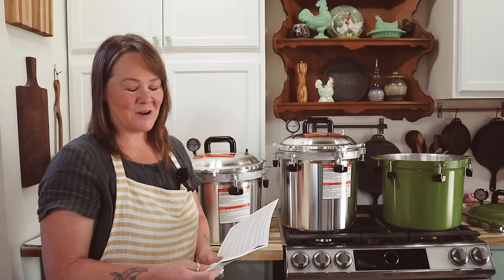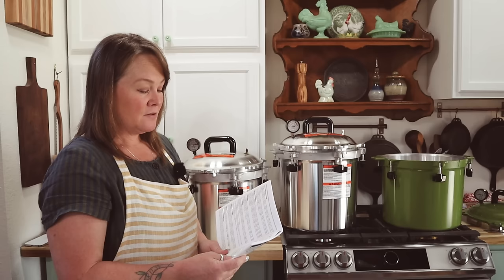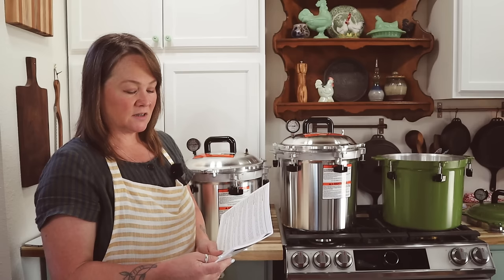Always store the pressure cooker canner in a dry area when not in use. While pitting is not injurious to health, if pitting becomes present and you detect it in the metal, then we recommend that the unit be returned to the factory for examination. Do not use the unit if pitting is present until it is determined the extent of damage caused by pitting. And so that's what I'm going to do.